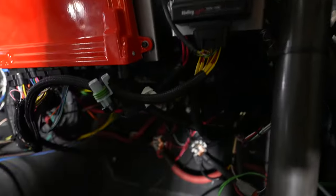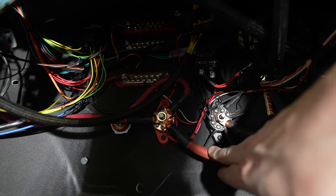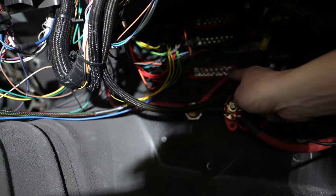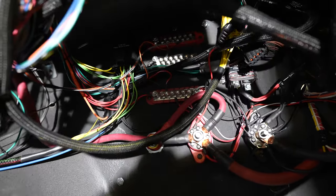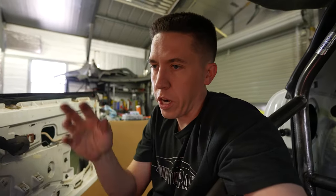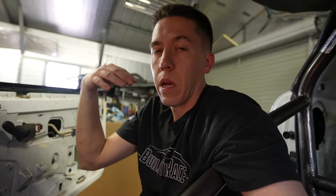Still need to bleed the brakes. The car is pretty much sitting where we want with suspension and everything. Inside the car, I built this panel that now sits up in here. We have the ground that goes to chassis, main power coming from the battery — everything taps off of here that needs power that the race pack doesn't provide, and it also powers the race pack. Then there's an ignition key signal wire, a sensor ground, and sensor power for powering extra sensors like coolant pressure and dome pressure.